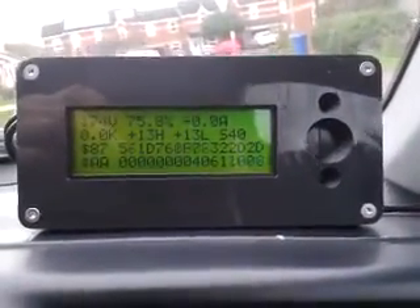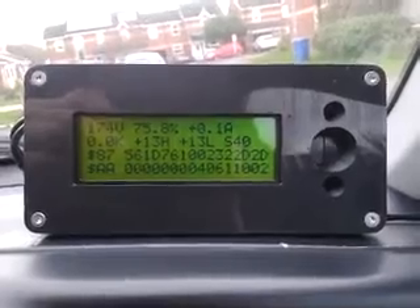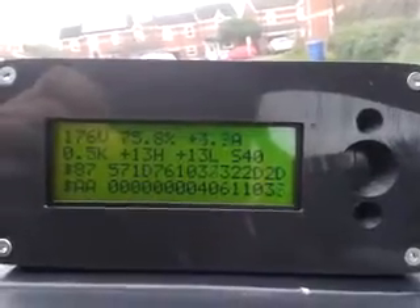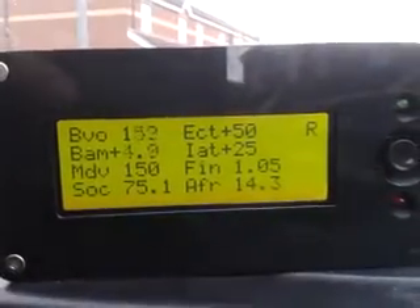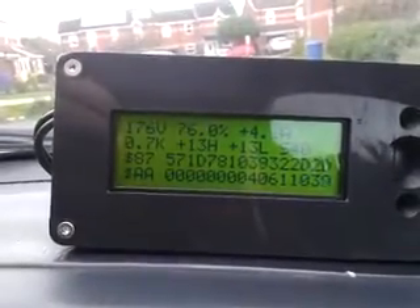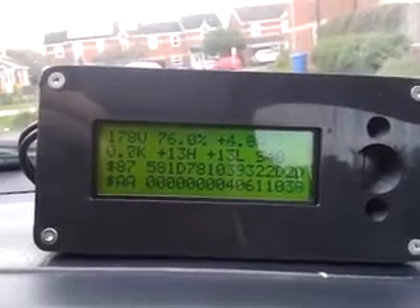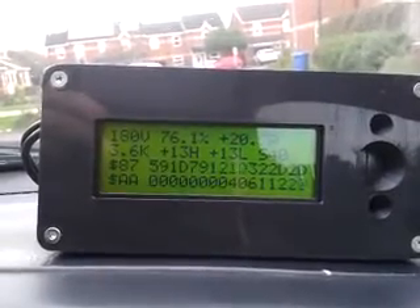On the steering wheel that's the IMA CNC plug-and-play joystick. Car's turned on and I'll start it up — the BCM gauge restarts when you start it up. I'm going to put some regen on, and you can see I've got about four amps of regen there. If we look on the BCM gauge you'll see it's about the same and the voltage will slowly start to climb.